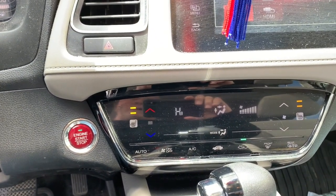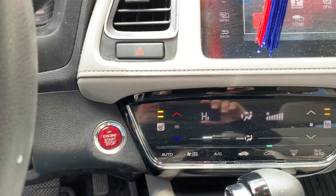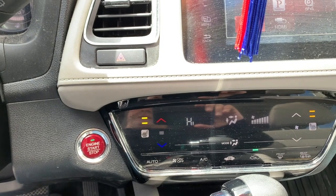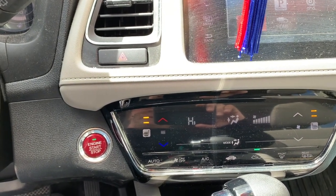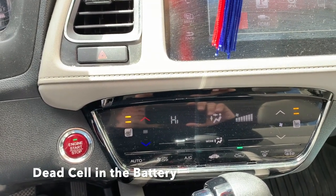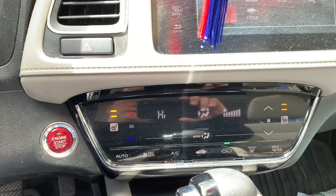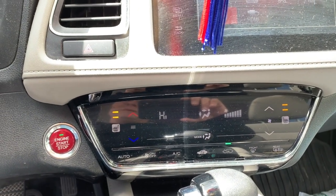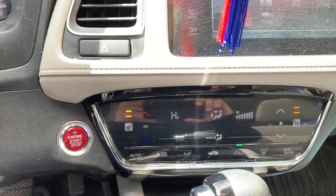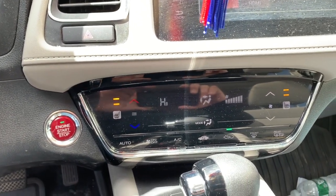If you have a dead cell in your battery and you're driving, stop at a corner store for a minute, and when you get back the car doesn't start — then you wait a couple minutes, try it a couple more times and it fires up like nothing's wrong — chances are you might have a bad battery. I've used testers that cost a couple thousand dollars and they won't pick that up in some instances. If a battery dies within a couple of minutes sitting, you might have a bad cell.